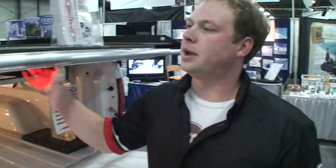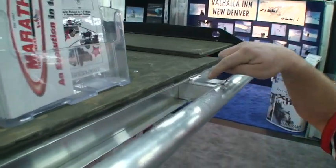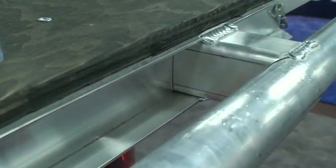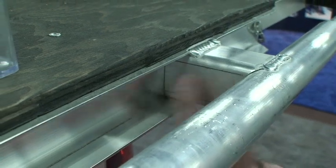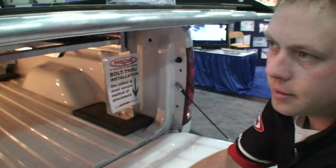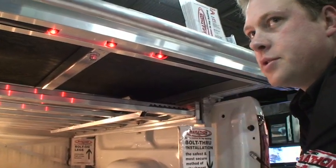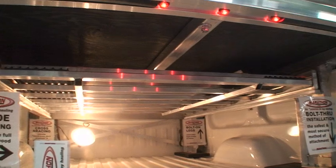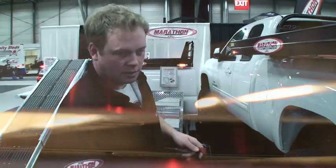The biggest thing that sets our deck apart from any other deck on the market is that our deck is extrusion-based — it's not box tube welded to box tube. We've got proprietary extrusions designed so that the majority of the deck strength comes from a two-inch piece being inset into the H tube and weld-zipped on top to keep it in place. For this to be sheared off would be almost impossible. The whole substructure of the deck is built in a similar fashion, which gives it a huge amount of strength. We sticker-rate the deck platform for 2,000 pounds, so we're quite confident you can run pretty much anything you want up on there.